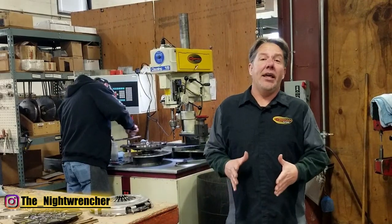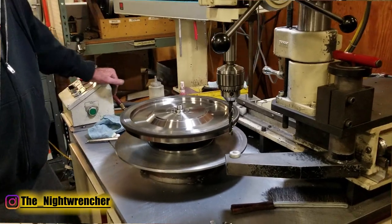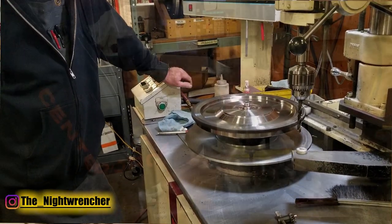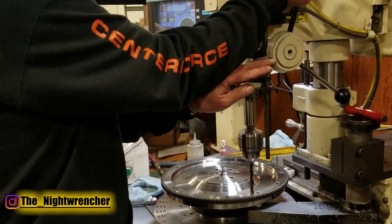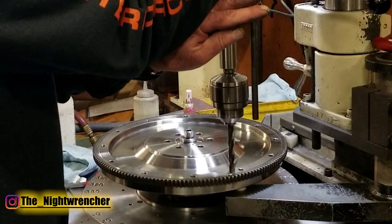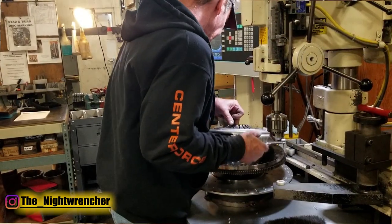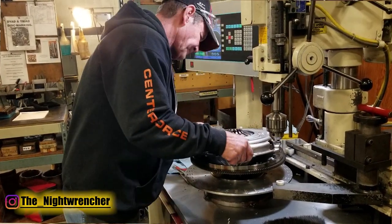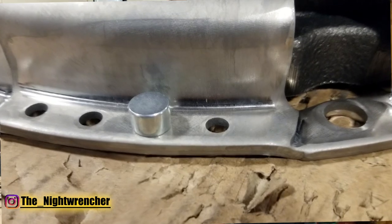The flywheel ended up actually being pretty messed up. I didn't hear exactly how many thou we took off of it, but it was enough that Mike felt it was important to go ahead and have the flywheel balanced. That's not normally something you do, especially with a brand new flywheel, but in this case because we resurfaced it and it's a used wheel, we're going to balance it. And because we need to balance it, we might as well take one extra step — we're actually going to match balance the pressure plate to the flywheel as well, so we know it'll be a balanced unit and it's not going to vibrate.